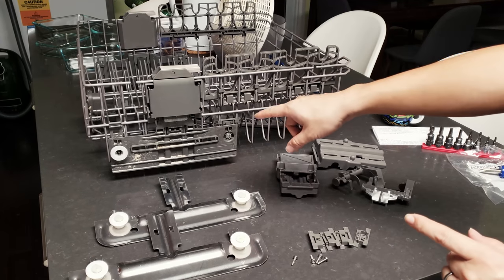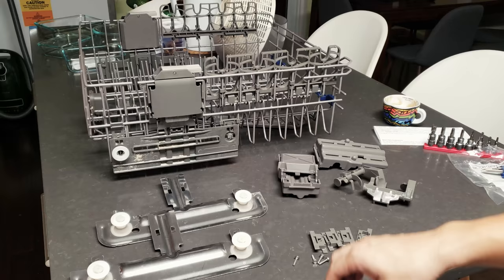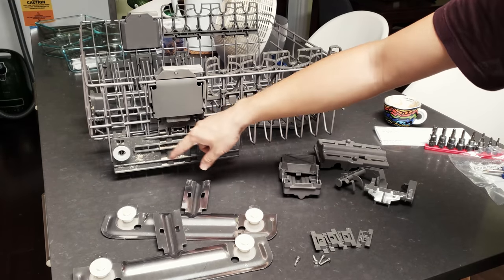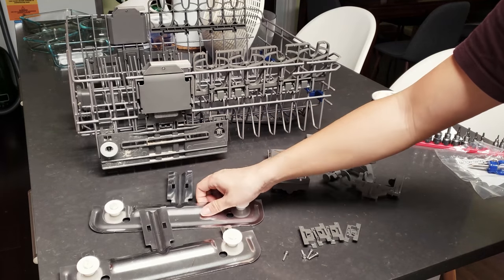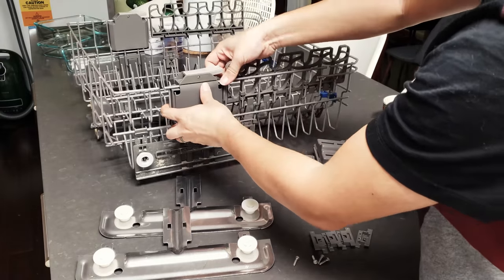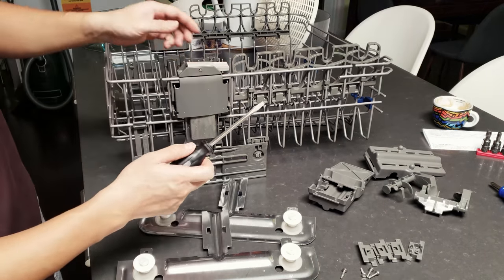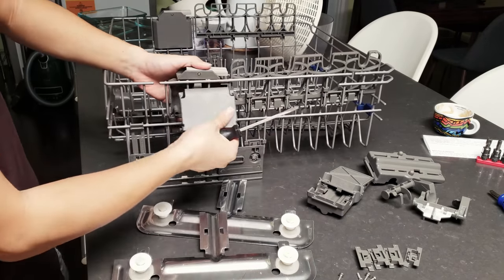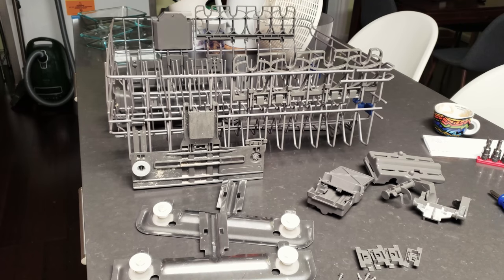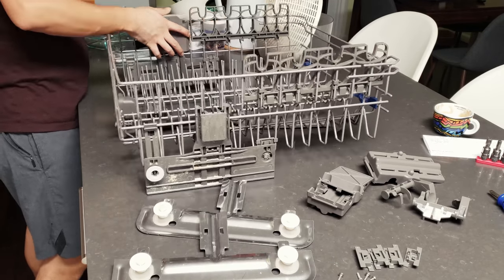First thing: we're just going to remove the old system. The entire assembly is not going to be used again, so remove it and toss it. As you can see it's pretty dirty in there. The reason they improved the design to metal is so dirt and grease don't attract and get stuck like in the plastic piece. This is much more streamlined and will keep the dishwasher cleaner. To take the top part off, use a flat-head screwdriver to pry it and it just falls apart — same thing on the other side.